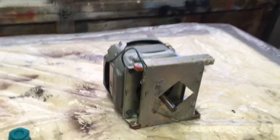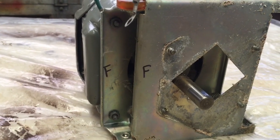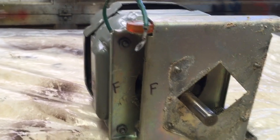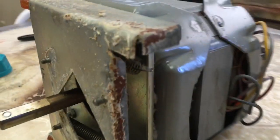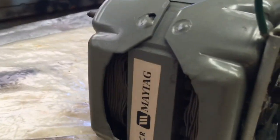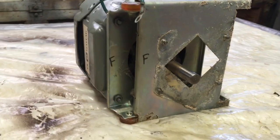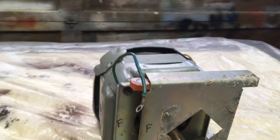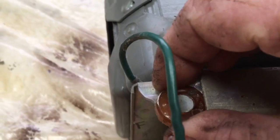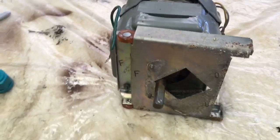Remove those and it should come out. The motor is out on the workbench — I've marked the plates as to which part faces the front. I've made a note that the springs are on the ends; that's the only option in this machine. I've seen some where they have a third opening for a third spring, but this doesn't have those provisions. This roller has got flat spots on it and it's kind of looking like it's seen better days, so it's probably a good idea to go ahead and get this knocked out.